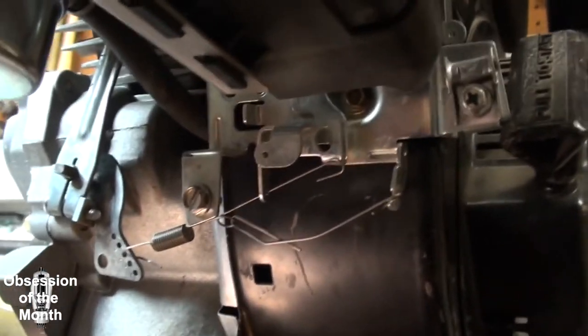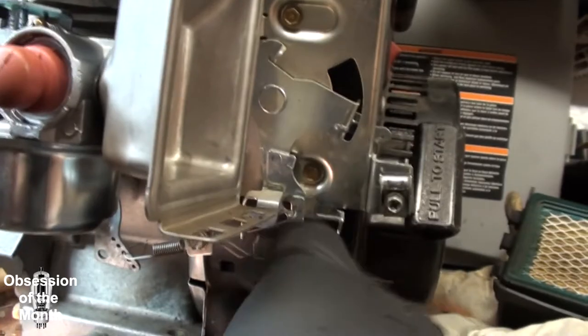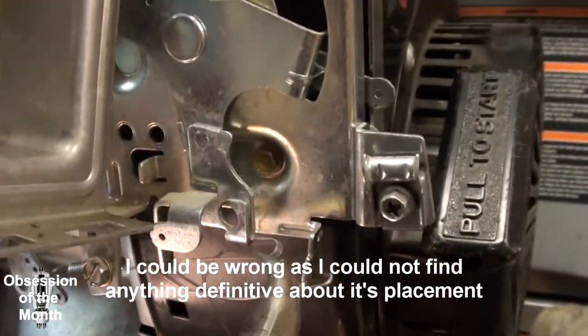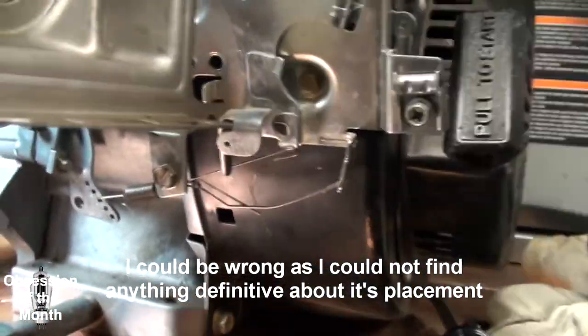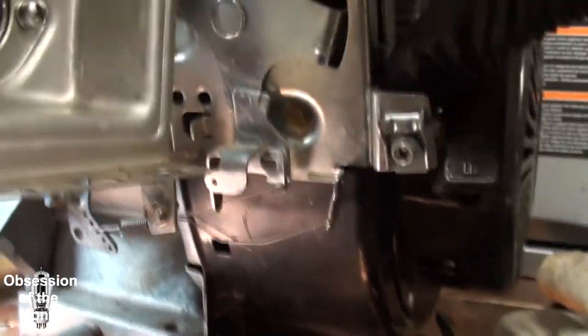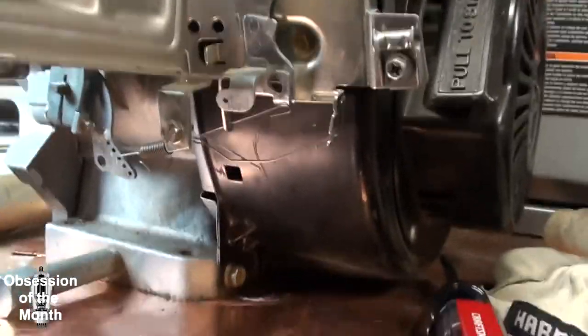The other thing is, somebody had this stuff monkeyed with. Get rid of this air filter so I can see what I'm talking about. Alright. They had this hooked like that. And that is not correct. This hook is supposed to be free floating. It should do that. This throttle engages that hook when it's at full throttle. I would think you would want a more controllable throttle with this, but apparently on a go-kart you have stop and go, so whatever.